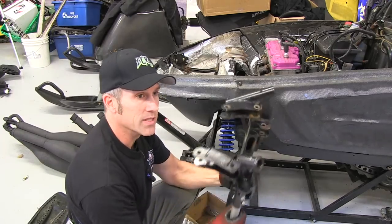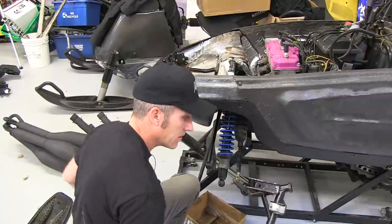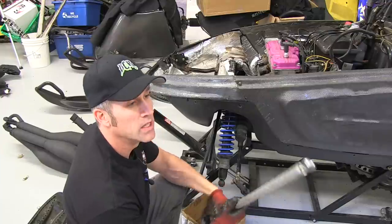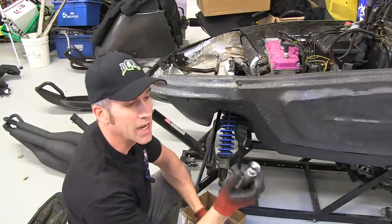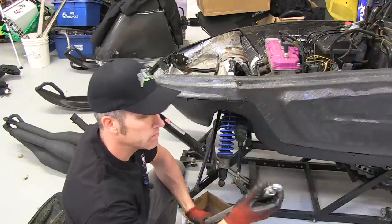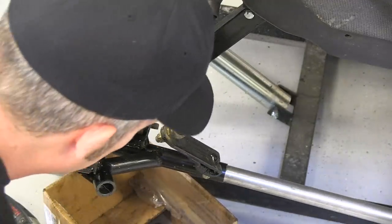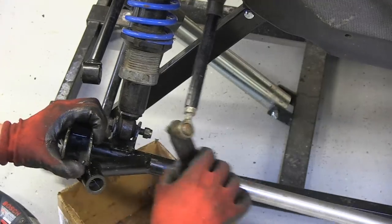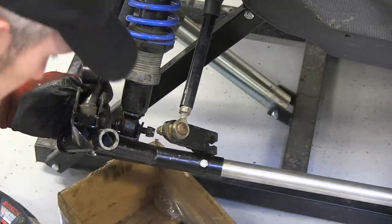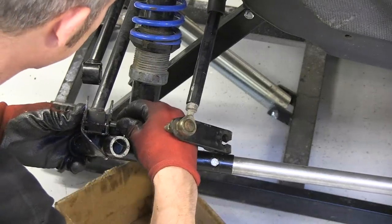There is a noticeable weight difference in these — probably 2 to 3 pounds. Say buh-bye. In a nutshell, installation is pretty much the reverse of removal. Now there is an adjustable heim joint on this, which I kind of like. It gives a little bit more movement and there's no rubber bushing in there to wear out — that's pretty sweet. I'm not going to tighten everything up right from the start because some of these things are a little tricky to get into place if they're all really tight, so I'll just pop them in, put the nuts on, and tighten everything up when everything is installed.